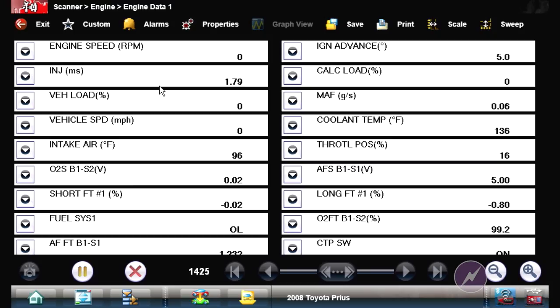Let's look at the two parameters we want to watch: the cranking RPM — remember, roughly about 1,200 to 1,500 RPM — and inside that cranking RPM window, jump over and watch the mass airflow. We want to see a bare-bones minimum 5 grams per second. So go ahead and crank it over.